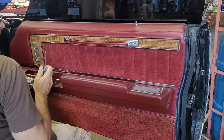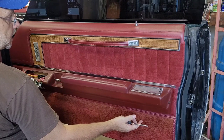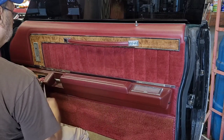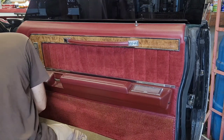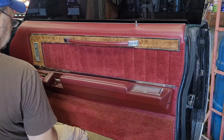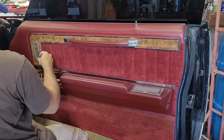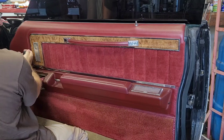Now, I can tell you that I've had this door panel off twice because I remember fixing this door lock once before years ago. And then later, I added illuminated entry to this car, so I would have had the door panel off to add that too. I never really tighten anything very tight at all, so these shouldn't be tight. This is an 11/32. They're just barely snug. You've got two on the window switch, two on the door lock switch.